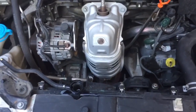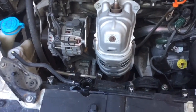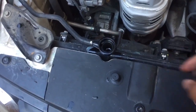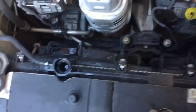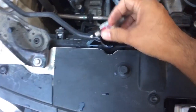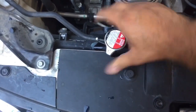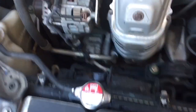What I do is bubble up all the air by keeping the reservoir cap open and letting the air bubble out. You can also press this hose — the rear hose — and see if any trapped air comes out. I've done that for a bit, letting the air escape from the rear area. Now it's time to close it up. Also topped off the reservoir — the extra reservoir should be between minimum and maximum. That's done.